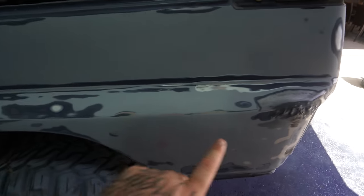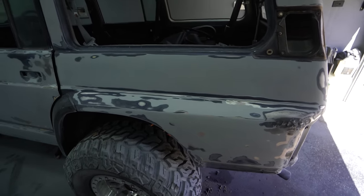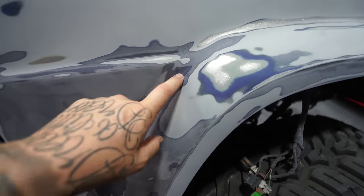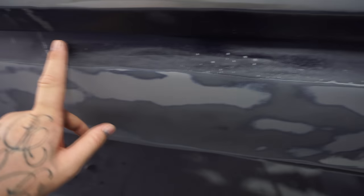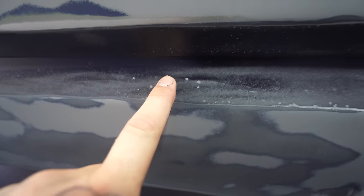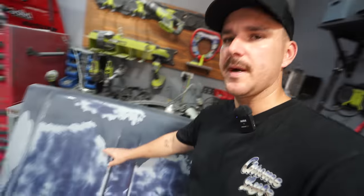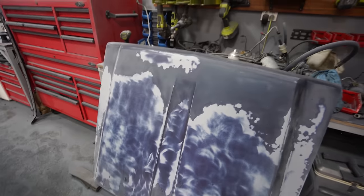This whole side was really quite bad. I assume someone had a crack at repairing it and layered the crap out of it — so that's all sanded back. The back is almost done. You can see the acrylic-based paint we're trying to remove — it's gumming up and not really playing the game. We've still got to do the bonnet. We've rubbed that down a little bit but we need to feather out the edge from where the clear coat was peeling. If you don't feather it out perfectly it's going to show up through the primer and through the paint. Still a lot of sanding left but we can see the light at the end of the tunnel.